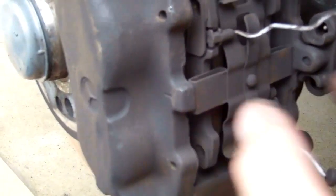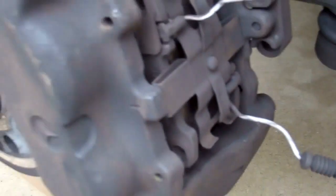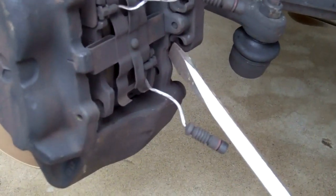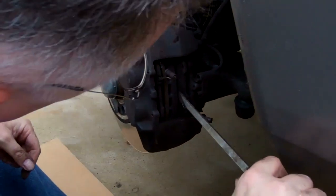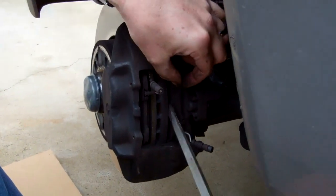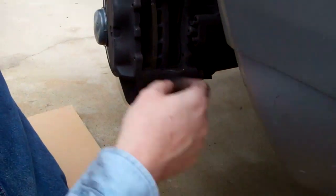The next step is to pull the brake pads out. I got the sensor wires clear of the little clips — you've got to be careful there. I'm going to take the big screwdriver and pry a little bit between the pad and the rotor, pushing the pistons back in. There are pistons on the outboard side and pistons on the inboard side. I'll pry to get some room to maneuver, then grab the brake pads with pliers and pull them out. The best technique was to go next to the rotor and twist. Once pried out, there's a ton of room and the pads come out pretty easily — one pulls out, the other pulls out, and there's a little metal plate in the back of each one.